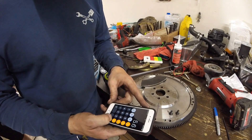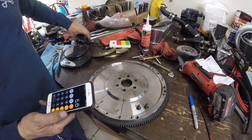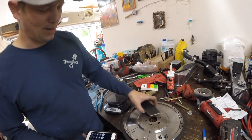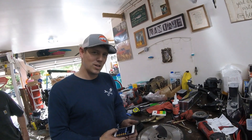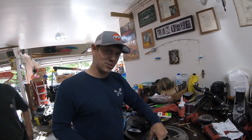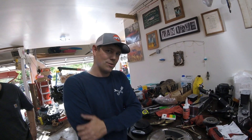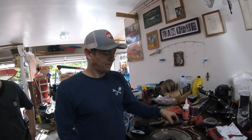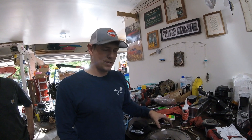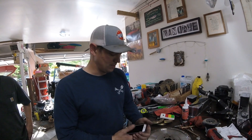We're going for a 28 ounce balance and we're about five inches out, so 5.6 ounces is what we're looking at. We're using a weed scale to actually measure our weight until we get there. If you look at the actual parts online they'll have a listing with a picture of the weights — the 28 ounce balance is just barely wider than the bolt holes, and the 50 ounce balance for a 302 is a lot longer. So: 28 ounce balance flywheel for a 351 Windsor, it's got to be 157 tooth and it's got to be for a 10 and a half inch clutch disc.